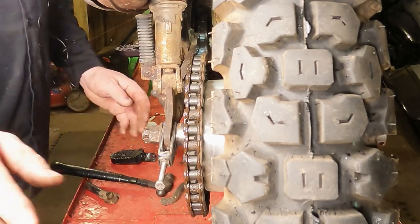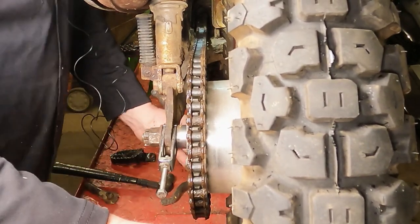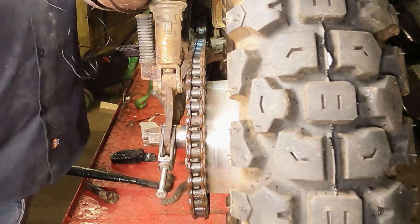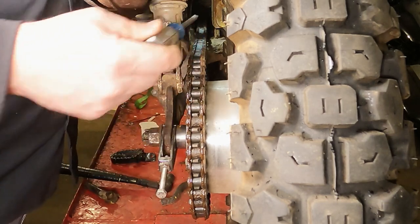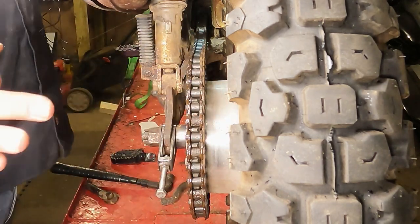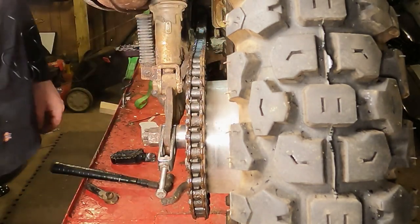What we're going to do to align this thing is we're going to first set our alignment. We're going to crank our axle adjusters in until it's aligned and then set our tension, because you want to set your alignment first — as you adjust alignment, that can affect the actual chain tension. Right here you can see it's pretty close. There's not really much of a bend; it's a pretty much straight shot. What I'll be looking at the entire time is looking up this chain to see if I have that angle, or if the top of the chain looks like a straight shot going all the way forward.